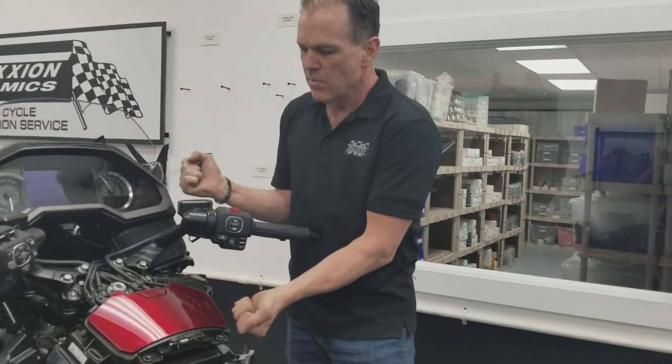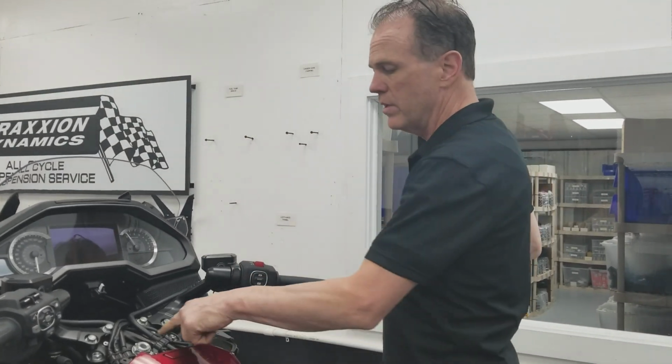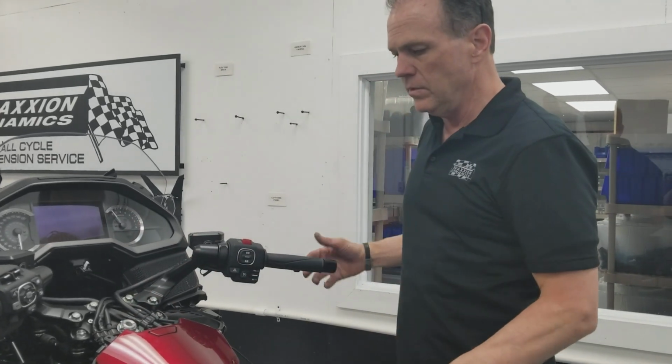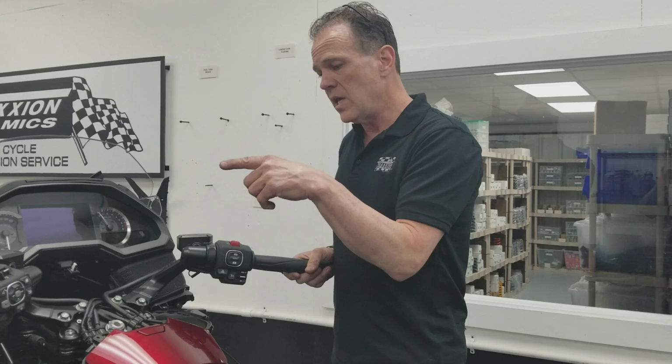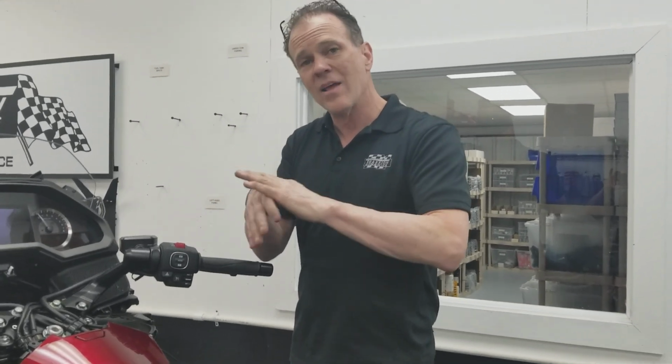We haven't done that, but hold it and then have a person on top torque the crown nut. Set the bearings and torque the crown nut. The other thing we found was the lock nut on the locking castle nut.